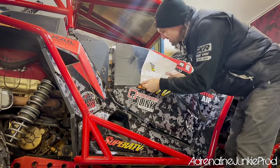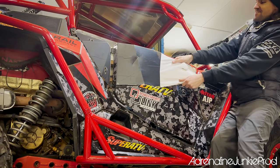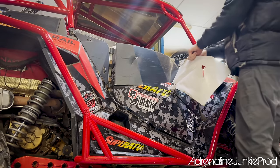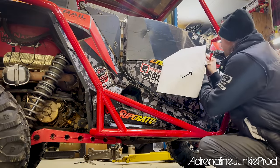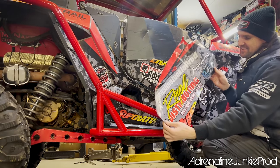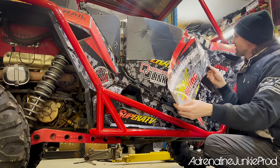As I mentioned before, you don't want to cheap out on material quality. The way this is coming off is all based on the fact that it was a good quality material. That is strong, but it's coming off clean. When you're peeling a wrap or any sticker, you want to maintain the largest surface area to pull on as possible. You don't want to rip it off in small pieces — as you can see, I'm pulling it off in one big sheet.